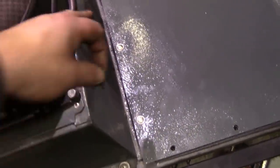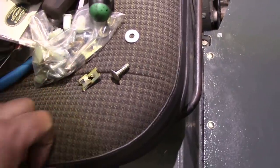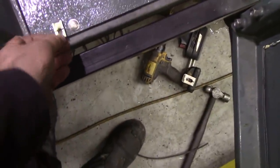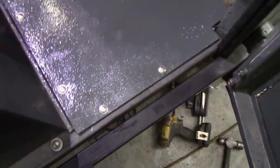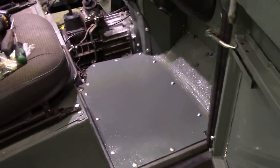The problem why these are difficult to get in and out is because the heads are stuck. I use the Acme bolt, washer, and nut underneath. The seal trimmed off — all nice and tight. These Acme nuts are just the right size so they'll actually self-lock as you're tightening them up, so you don't really need another spanner underneath. You can see they're nice and flush and quite easy to get out. I put another screw in that corner even though the bellows cover goes over there — just to keep it in line so everything's perfectly aligned front to back.